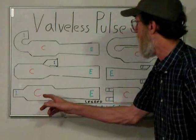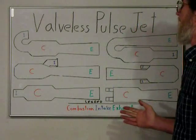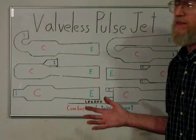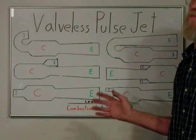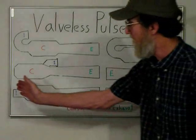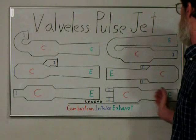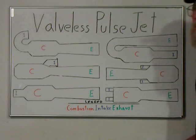These other designs where the intake faces toward the front were possibly done as an attempt to get a little extra air pressure. As far as actual ramjets, it's my understanding that you have to have really high speeds — hundreds of miles per hour — to get a true ramjet. So in cases where you're putting it on a cart, bicycle, or motorcycle frame, you're not going to get a true ramjet. You will get some benefit from the pressure, but it also causes other problems with the way the gas functions. So that is pretty much it for the most common design choices, though there are far more exotic ones of course.